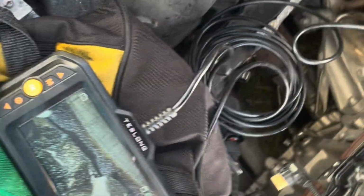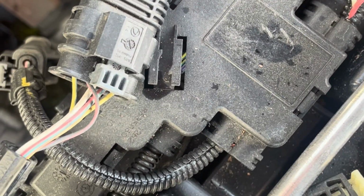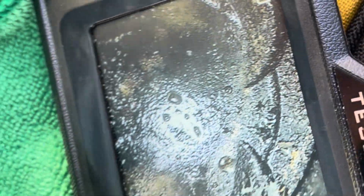Okay, I'm scoping out some of the cylinders, and overall, not even looking at walls on the side. Oops. All right. I'll lower down the cylinder a bit more, but the valves open there. Hopefully all this water intrusion in here didn't do too much damage. Let's check out this cylinder 3. Got a little bit of water in there. I should be able to dry that off and blow it, but this one will give us a good look at the walls.